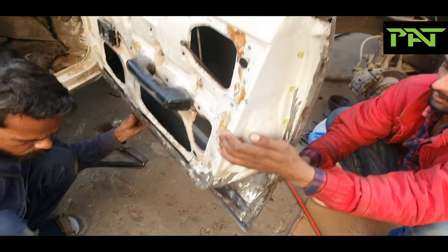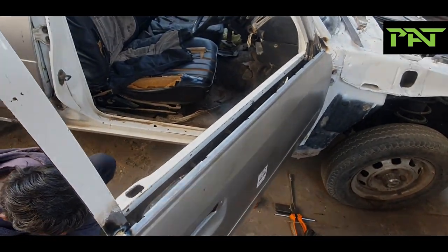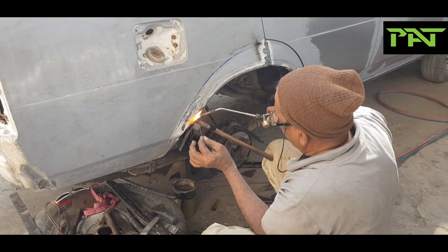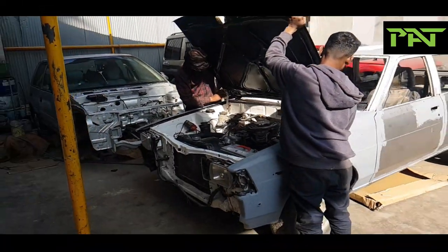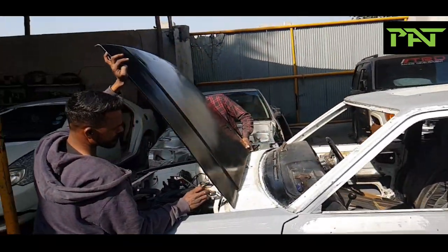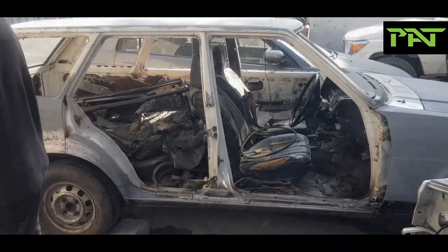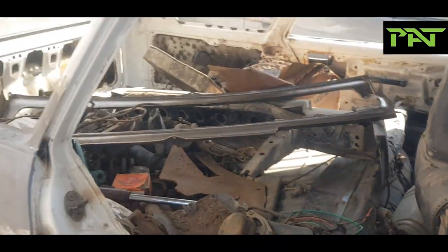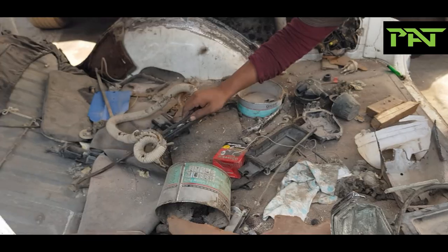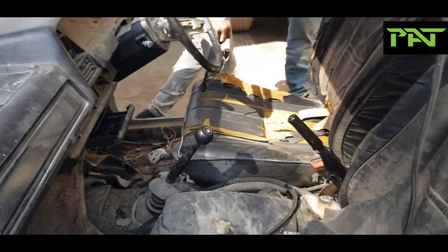Now on the screen, the door panels are replaced. Now we are working on the rear wheel arches — the wheel arches have been changed from the interior. We have replaced the bonnet and the fenders so that we can give a good finish and streamlined look. We are going to finalize as per standard pattern. Now we will start dismantling the cabin so that we can clean it and repair it with rust repair and paint.